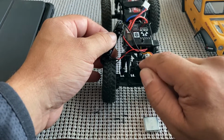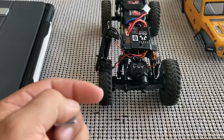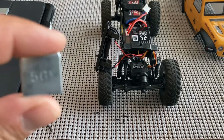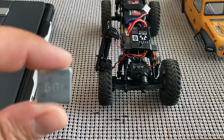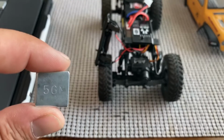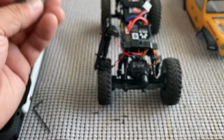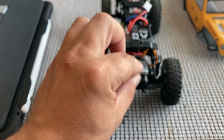A nickel will work perfectly. Use some glue, some two-sided tape, whatever works. The only thing that you're going to want to make sure of is that once you have this placed, before you adhere it to the servo, you make sure you've got clearance for the suspension to travel, that you're not either hitting on the frame rails or on the inner chassis, specifically the electronics or the body mount posts. But once you've got it preset, you've tested it for clearance, you're good to go.